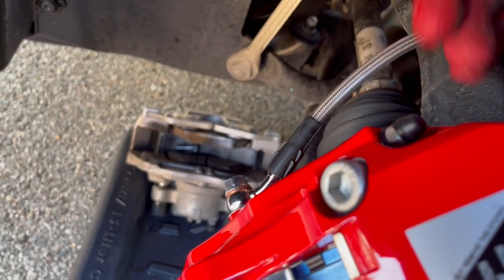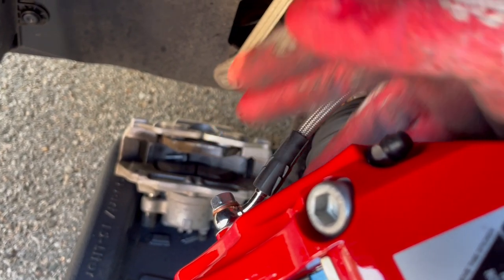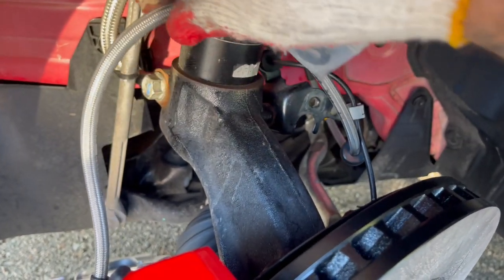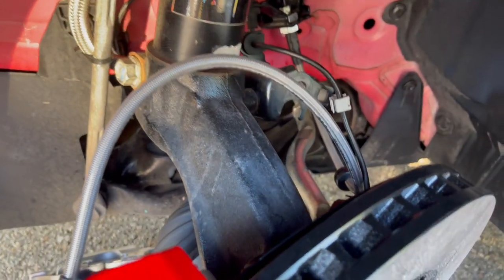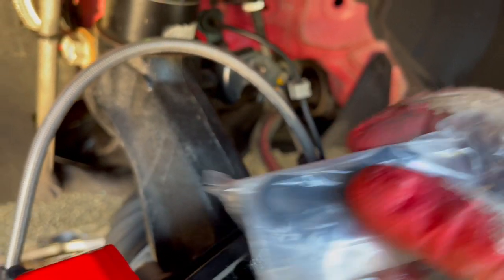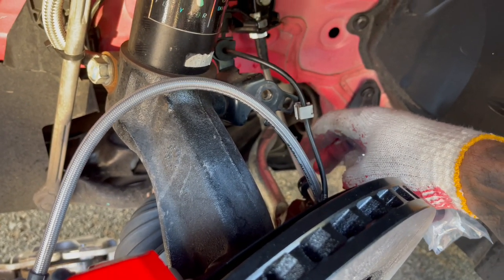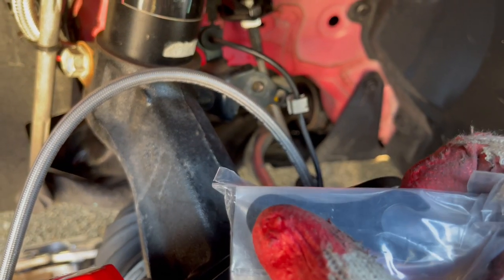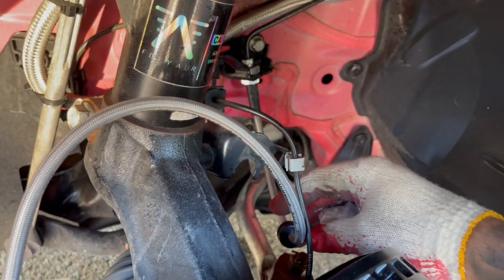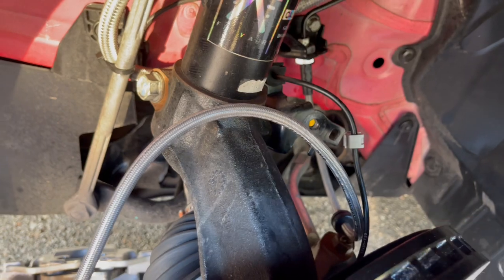As you can see, everything is done here — it's connected and some brake fluid already started flowing through it. To secure the line so it won't move, the kit provides these brackets. I believe this holds the stainless steel line through the rubber grommet they give you. The end goes where the 12mm bolt is, you bolt it down and attach the hook end at the bottom — then everything is all set.